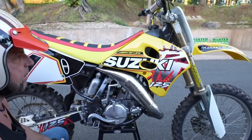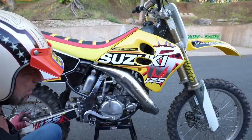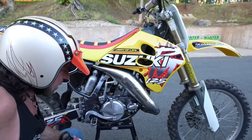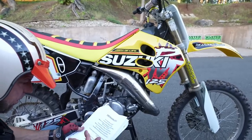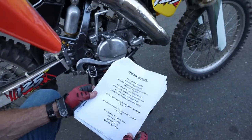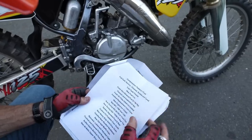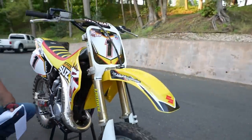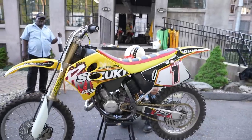Went through the detail department for the full Monty detail — they stripped the bike right down: tank, seat, all the plastics came off, the wheels came off. It was steam cleaned top to bottom. It cost $500 just for the ignition system — it's got a new PVL ignition system and they set the ignition timing. New spark plug. Full carb service: cleaned, re-jetted, tuned the carb. The fuel tank was flushed, new fuel line. It's running VP at 32 to 1 with Bel-Ray. The air box is cleaned and inspected, and a new Twin Air filter was installed.